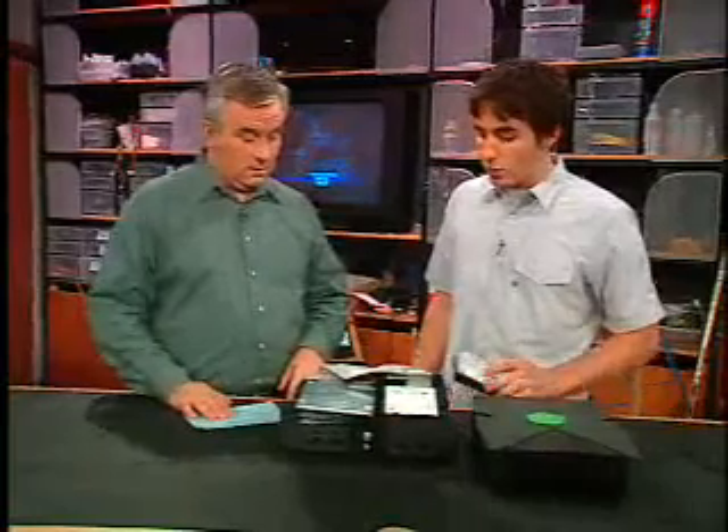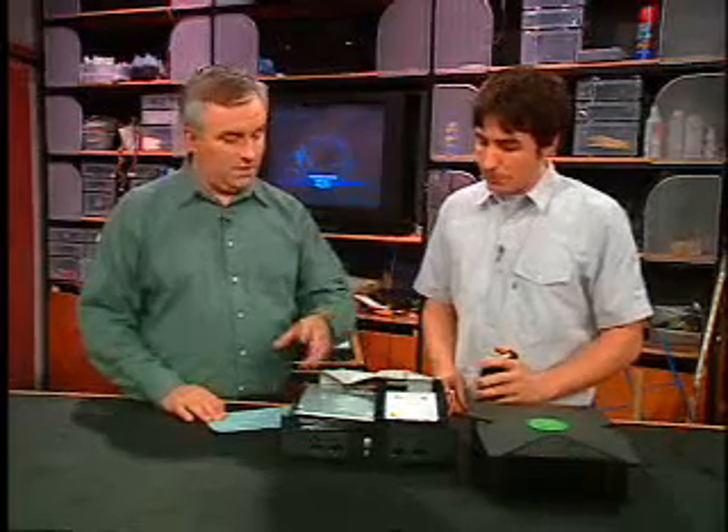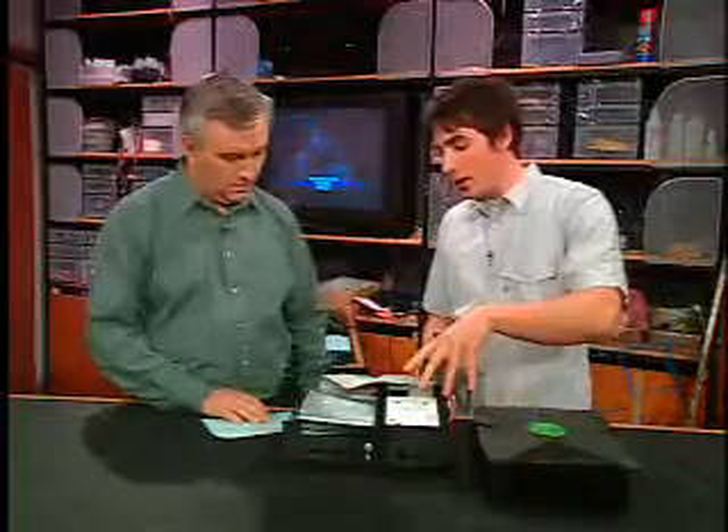This is the drive right here. Modders tend to like Maxtor over other brands because of hard drive locking — you have to perform that at the very end of installing the drive. Maxtor drives are the most likely ones you're able to lock; they seem to be the most compatible with this modification. As for 7,200 RPM versus 5,400 RPM, it really doesn't matter. The 7,200 RPM drives get a little hotter, so some people install an extra fan to get rid of the heat. For media libraries, speed is not of the essence, and 5,400 RPM drives are cheaper as well.